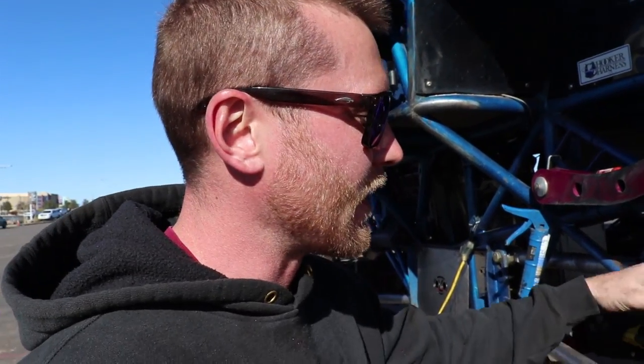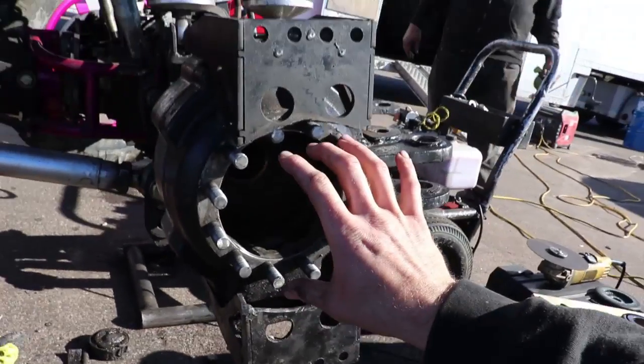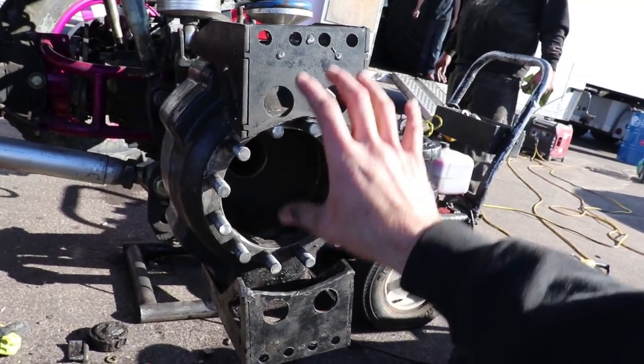Back together, and we got the kingpin bearings in, bearings, races are in, and then we put the kingpin caps on. So these are the caps right here. These bolts clamp it down and you have to make sure that the knuckle is properly aligned on the kingpin up or down. So it's centered on the kingpin up and down.